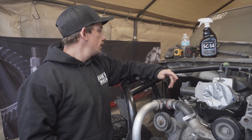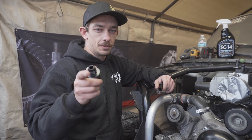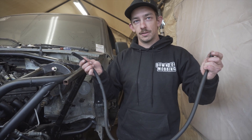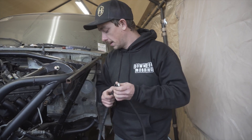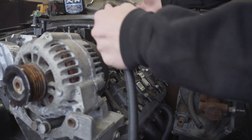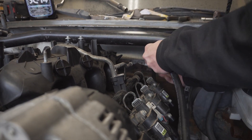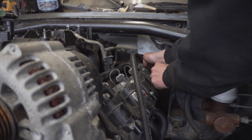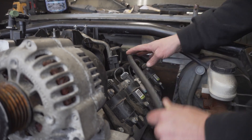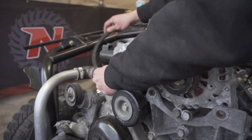So we are going to run some venting. I'll show you guys how we're going to do that. We have three-eighths hose right here and we're just going to bypass both valve covers together. I'm going to install this — I'll probably just tuck it under here and zip tie it up later, then run it over to this valve cover.